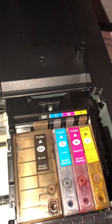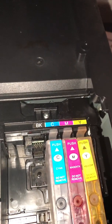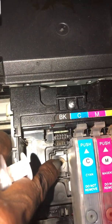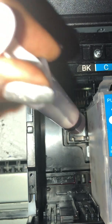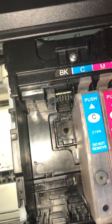That still didn't work, so what I ended up doing is taking out all of my cartridges. Right now I'm only going to take out one — I don't want to take them all out. But for each color cartridge, it has this little nozzle here underneath the cartridge. So what I did from there with the alcohol mixture — making sure the paper towel is under there — I stuck my syringe in and just pushed down. That unclogged the little heads and you could see the alcohol go through, absorbing whatever was clogged in there.